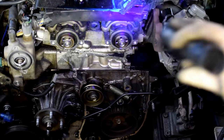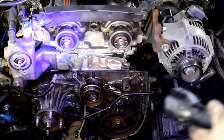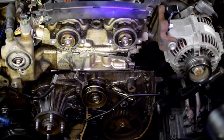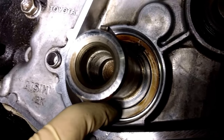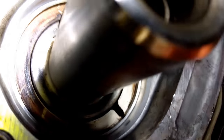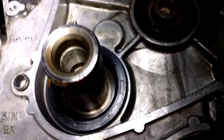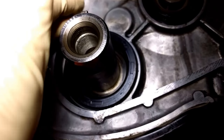That would be your leak — that's pretty obvious. Doesn't get a whole lot more fluorescent than that. It was just pouring out of these seals. Here's the crank — I just pulled the seal out. You want to make sure it's really clean — mirror spotless on that sealing surface. So we'll insert this; I'm going to grab a little bit of oil just so it slips on nice. You just tap that into place and you want to make sure that it goes in real straight — you don't want it to get off camber. You want it to go real flat, straight, and on. That's the crank seal done.